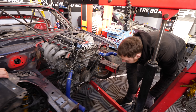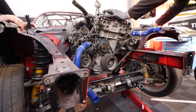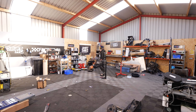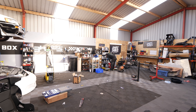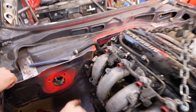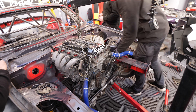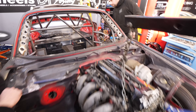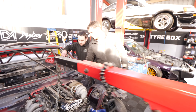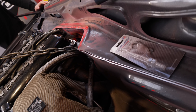Hold on - you're resting on the roll bar. Well, this is the furthest it's ever got before. It's not bad so far. Wayne's now coming for moral support or to steal some things. This pipe here feels like it needs to come off. Yeah, that's the thing you wanted to relocate. You might get it behind the anti-roll bar if you did that. It's still got room to go back there if you can clear that. I think the turbo might be okay. Yeah, it's more the down pipe - the down pipe is in trouble.